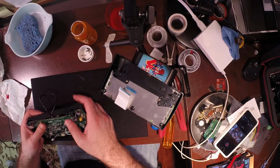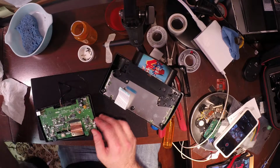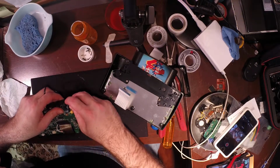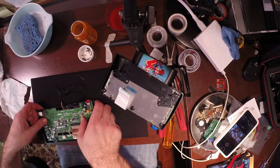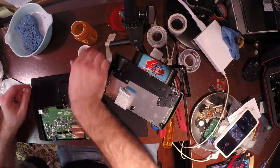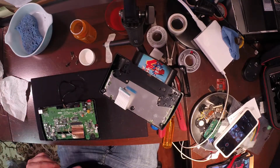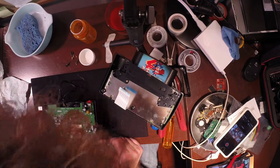And I'll show you what to do with that excess wire here in a moment, but what I want to do meanwhile, don't forget, before you lay this in there, is to put this darn select start button on, because there's no way in Sam hell you'll get that on there without having to remove this board once again. So we want to avoid those kind of things. So tightening down this board. I know the black screws are for the exterior of the case, not the board.